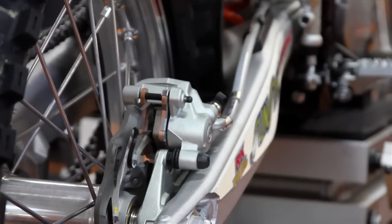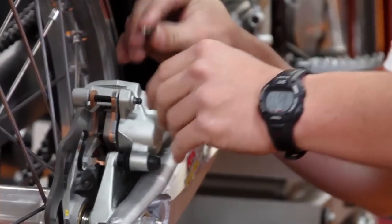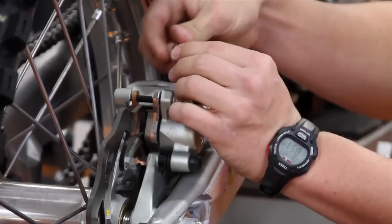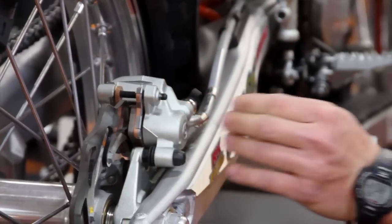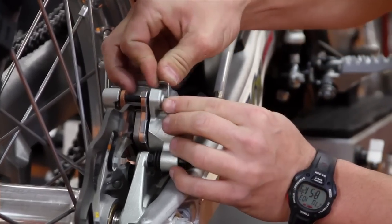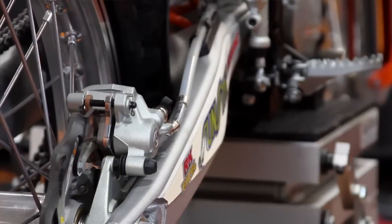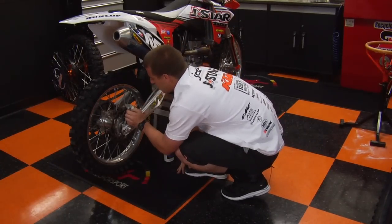Then just slide your pin through and take the R-clips. There's not really a direction these go on, but we like to keep them facing over the top of the caliper so they don't hang out and catch anything. Go ahead and put this one on, snap it down — it just goes in the middle of the clip. There's like a hump and that's where it sits, right there in the middle. Put this one on and then you can pump your brakes back up and you've just changed your pads. But I also like to take some safety wire and wire-tie the clips, just as a precaution so they don't come off.